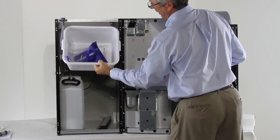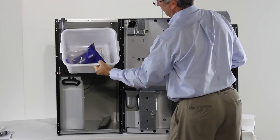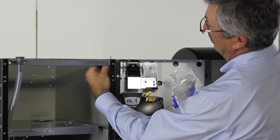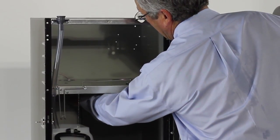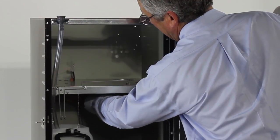The 4 10mm bolts and washers needed to attach the base can be found in the base kit. Using these bolts, attach the coffee machine to the base unit by inserting the bolts through the holes in the base top. The harness for the float switch has pink and brown wires. The switch wires will be routed through the back left of the base into the back of the CREA.